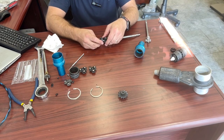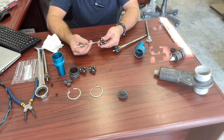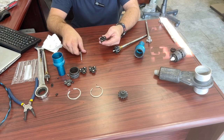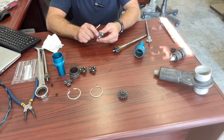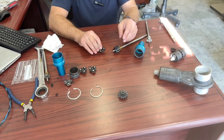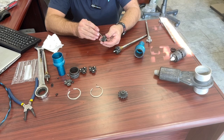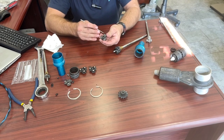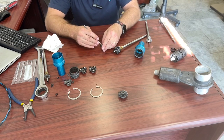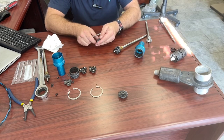Basically, there are several wear spots on these. One of the wear spots is actually this right here — this should be raised above the gear. It's such a tight tolerance that the only way you're going to know is to put two of them together and see if it hits. The other wear part on these is this line on the back here. What usually happens is that these hit because they're not on that anymore, and that's what catches if these are worn out.